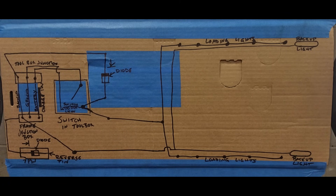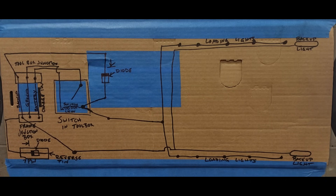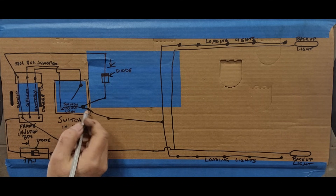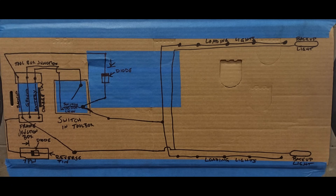This setup could be done with a relay since you're utilizing two different contacts, but relays fail - they get wet and whatever. I don't want to put in more relays than necessary. These diodes have no moving parts: you solder them in and they're done. Two simple diodes make it so I can use those backup lights when I want them, as I want them. I hope that was clear.